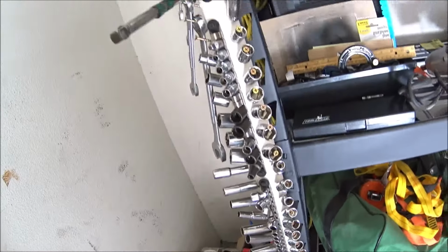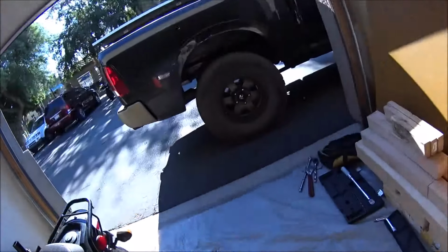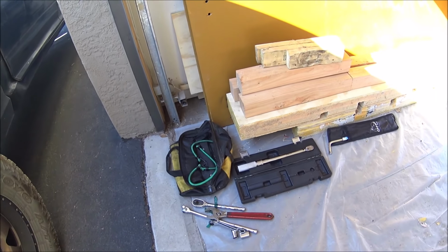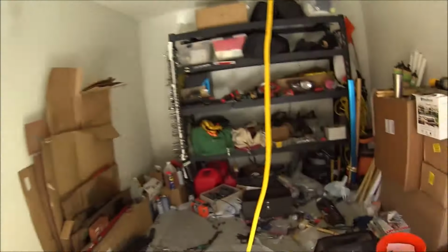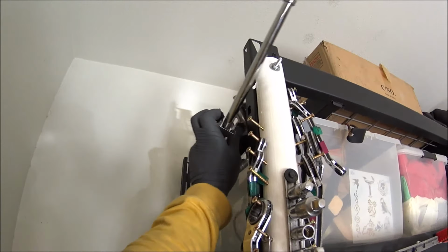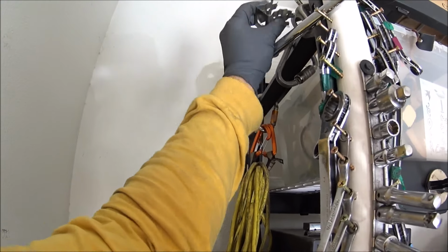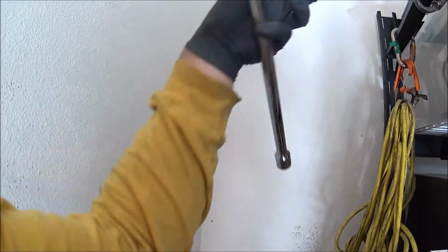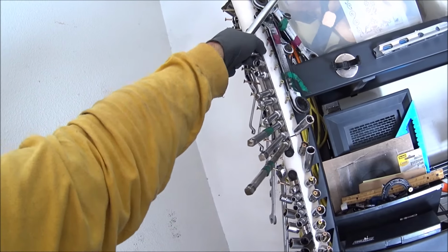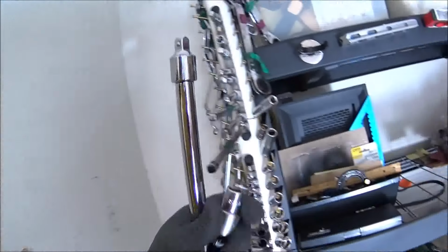So for my truck, I have the Airlift 5000 airbags back there. They have 9/16 bolts on them. So I need a 9/16 deep well socket for that, to reach that hard to reach bolt, as well as an extension, 3/8 drive. That's what I had. And then I have an aftermarket Hellwig sway bar, so I just need to loosen those back two bolts to get the clearance, and that's 17mm.